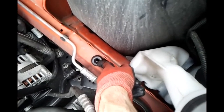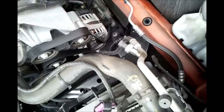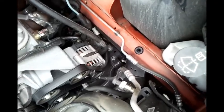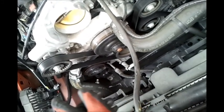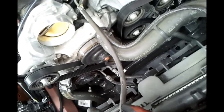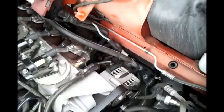There's a grommet down there which you may remove if you need to use that hole, or just leave it — it doesn't matter. Now that you've got this whole area freed up, you can install your aftermarket cold air intake system or whatever you're going to do. This is a pretty simple procedure for removing your air box. Just make sure you do something about the PCV — you can't just leave it dangling. Either reconnect it to your new intake, put a breather on it, or something, because otherwise you'll get crankcase gases and oil in your engine and could have a fire or other problem. Make sure you deal with that.